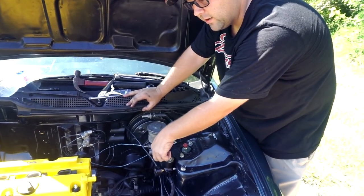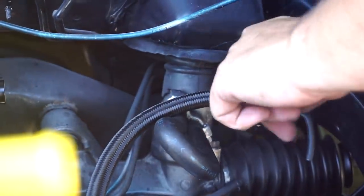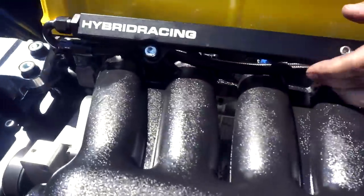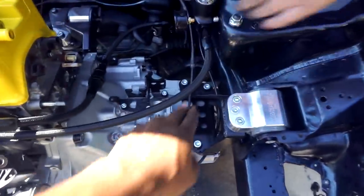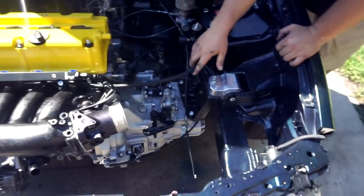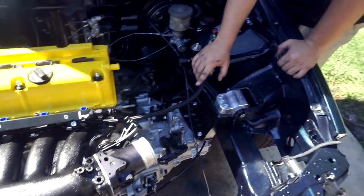It's meant so you keep the regulator here on the shock tower. You're gonna feed in from your standard feed line - your hard line right here comes with our adapters and everything feeds through filters, kind of tucked here. Comes into the rail, we 180 out the back of the rail, come around. He actually had the idea to tuck it under the rail here and it actually came out pretty nice. The only line you truly really see is this one - that's really the only line you're gonna see on the swap kit itself.